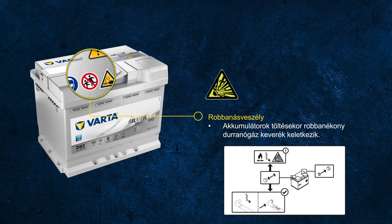Sometimes for logistic reasons both vent holes are sealed with a plug to avoid acid leakage during transportation. It is absolutely important to unmount one of these protective plugs before putting the battery into operation. Otherwise the creation of internal gases will lead to significant overpressure and ultimately burst the container.